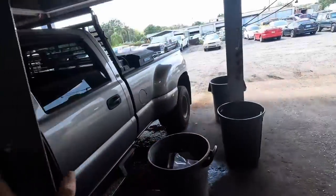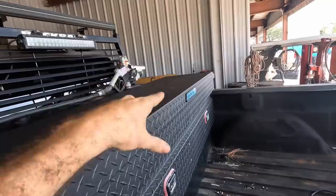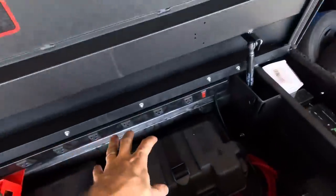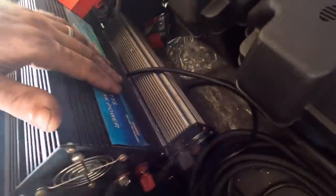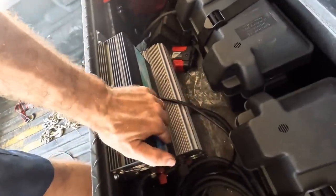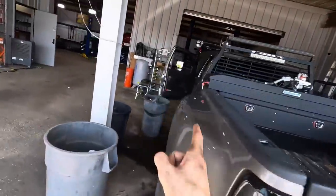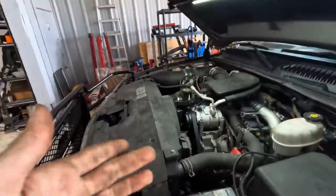On my Duramax here — in the last episode on this truck we ended up installing some power inverters and a battery bank along with some electrical stuff inside of this toolbox. This is an ongoing project that's been happening for several weeks. It's going to consist of two deep cycle batteries, junction blocks, breakers, fuses, one sine wave inverter, one heavy duty non-sine wave inverter, and possibly one more larger pure sine wave inverter. I do not have enough amperage on my 12-volt DC side to feed that constant load should I ever have to hook up a bunch of equipment.